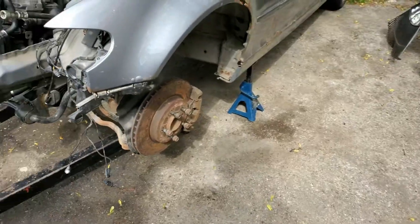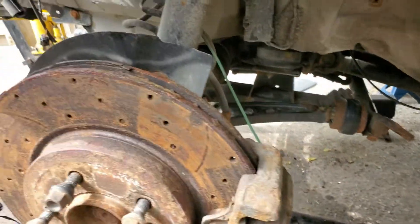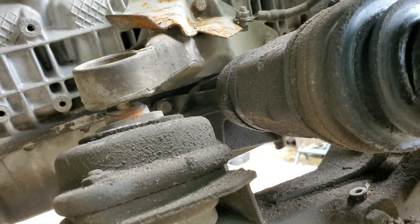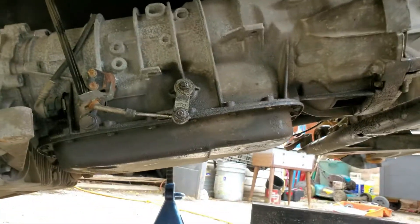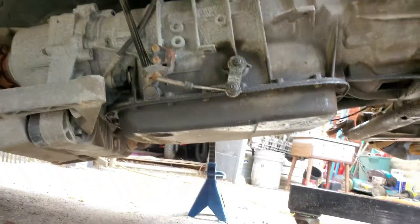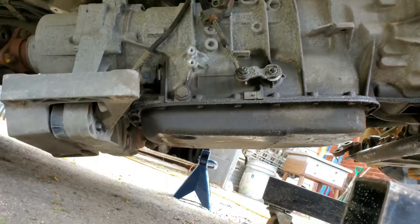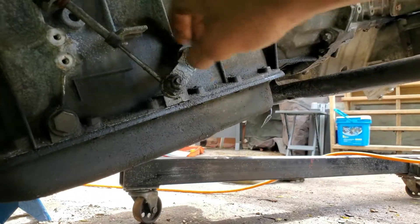We're back the next day. I thought about this overnight - it got really late and dark so I figured I'd come back today. I've never actually done an Xi before. Looking it over, I think I'll have to disconnect the axles from the actual motor - there are four bolts on each side. Before I get into all that, I'm gonna disconnect the shift linkage before I break it. For the auto shift linkage, I'm gonna unbolt that 13 mil and those two 10 mils. Now I've got a jack under here - this thing can just slide off.